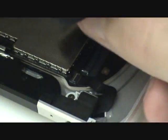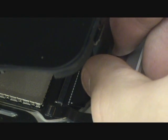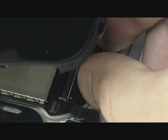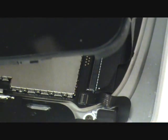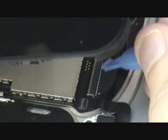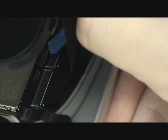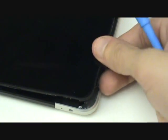The final cable we have to reinsert leads to the digitizer. We'll insert this cable into its two ports and flip the black tabs in the downward or horizontal direction. This will hold the cable in place with tension and make sure that each of the pins has a secure connection. We'll also want to bend this digitizer cable towards the inside of the iPad.